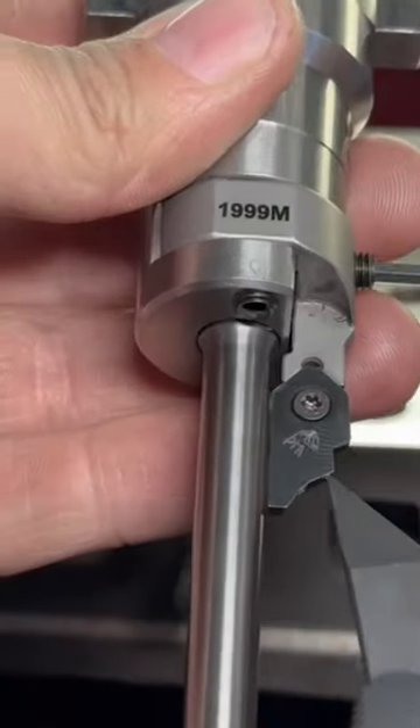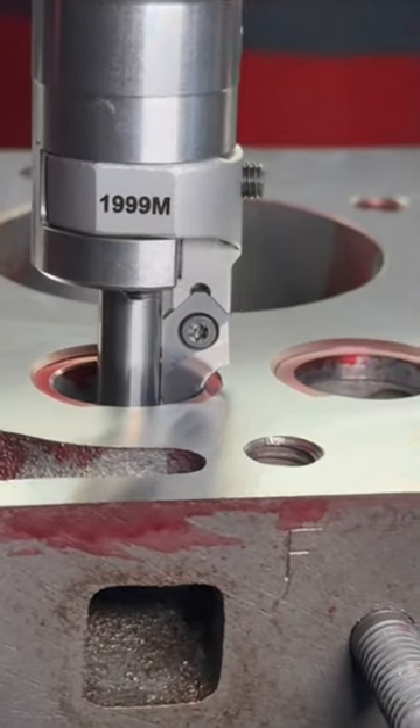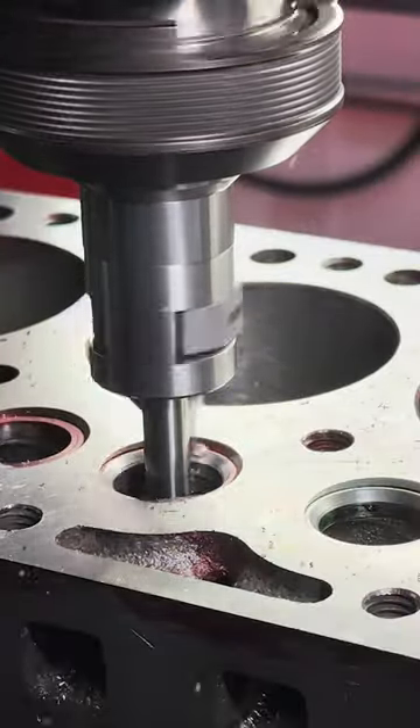We're using a micro-tip holder and a micro-valve seat cutting blade from Goodson Tools, since our standard cutting blades can't be adjusted small enough. The seats are cut with a 60 thousandths wide 45-degree seat angle, with a 30-degree top and a 60-degree bottom angle.